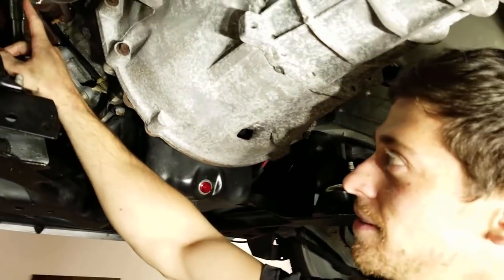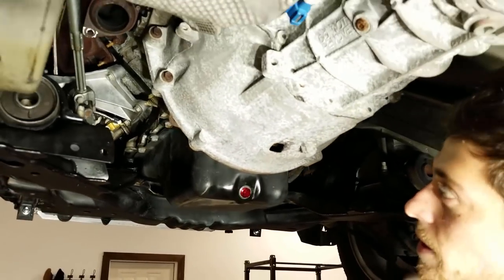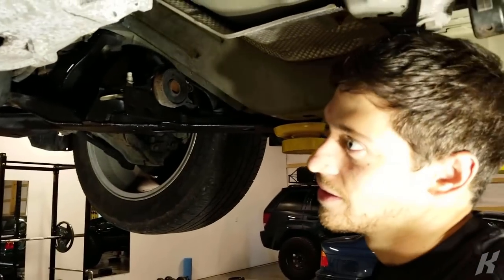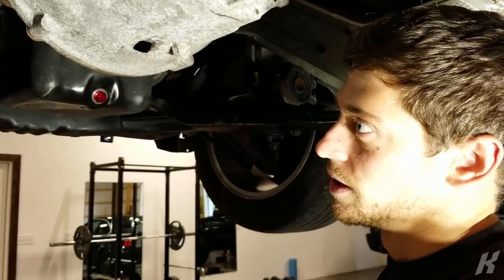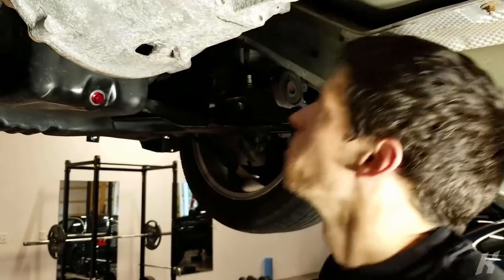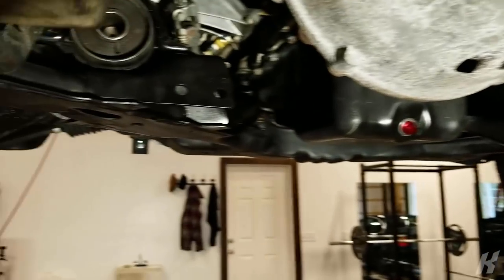I drilled out the studs that broke, and it was horrible because the studs are hardened steel, so you have to use hardened drill bits. I used cobalt drill bits. I broke like 7. It took like 8 hours probably. The better way would have been to use a torch to burn it out, but I don't have a torch. So next time.